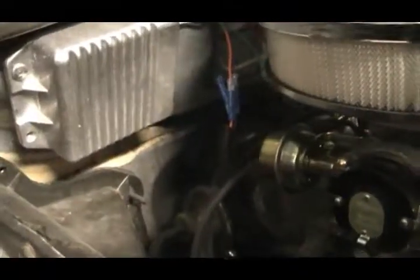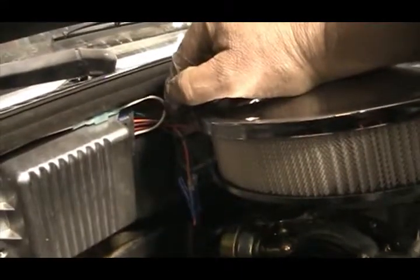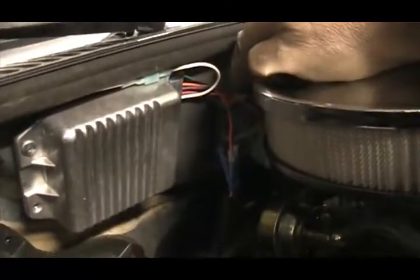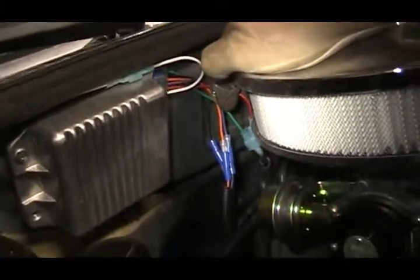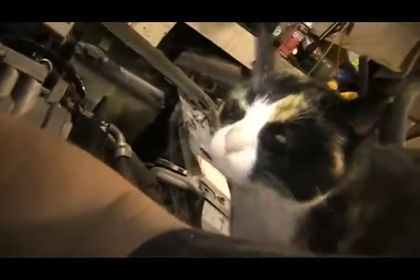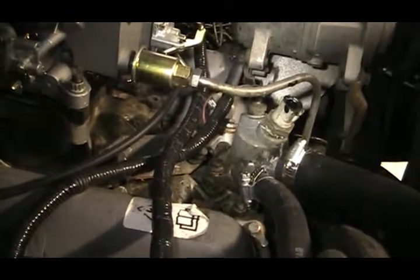You've got a power wire here — that's your red — and then your white one here. The white one is 12 volts in crank. And then the other is the distributor. And then the green one of course is the coil negative. We've got the regular two barrel, and it's just a 2100. I had to cut the EGR valve off as the end of it was broken.